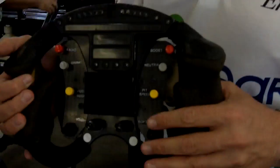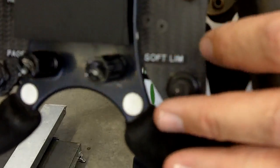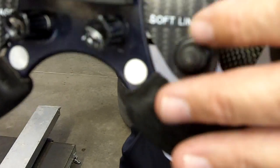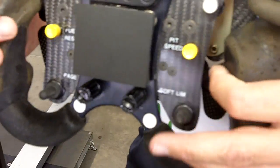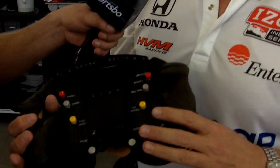The speed limiter reactivates when they come back up to 60. The soft limiter has three settings: 10,295, 10,290, and 10,285 RPM. If we want to run closer to the soft limiter without hurting our speed, we bump up to 10,295. On ovals you want to be as close to the RPM limiter as possible — especially here in Vegas where it's warmer. Back in Kentucky, we run it lower because it's colder and the engine operates better at lower RPM.